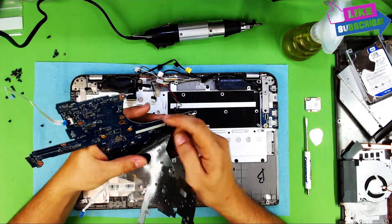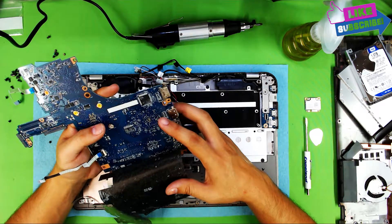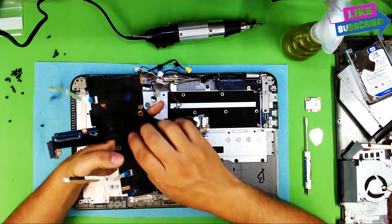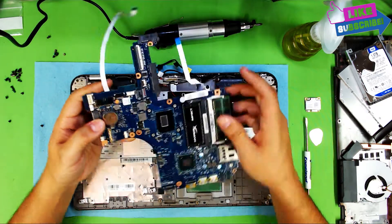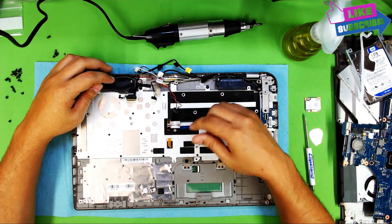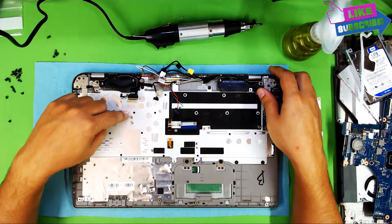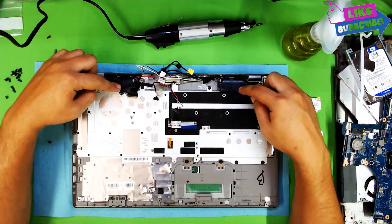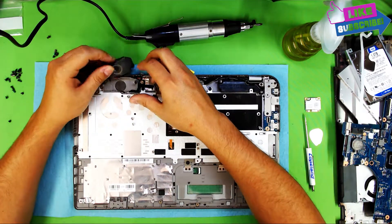You can remove this plastic cover to clean up your board, because sometimes there are ants or small insects that get stuck to the board and cause a short circuit. I've had lots of clients here with boards full of ants that caused short circuits. Make sure your protective plastic cover is clean. The speakers are down here — you can just lift them up and replace them. If you want to replace your keyboard, you've got to unscrew about 20 screws holding it, and then you can take the keyboard out. The speakers are really simple to change.